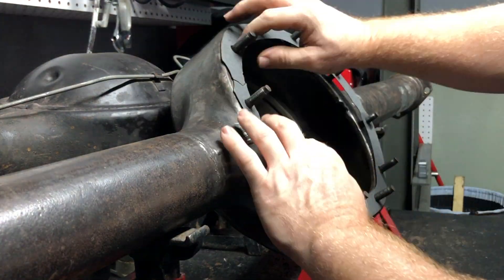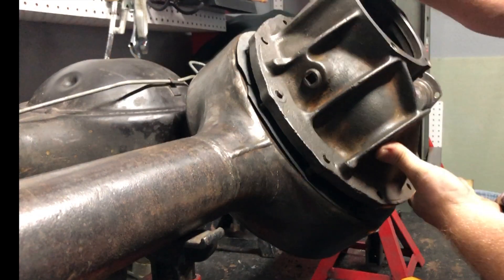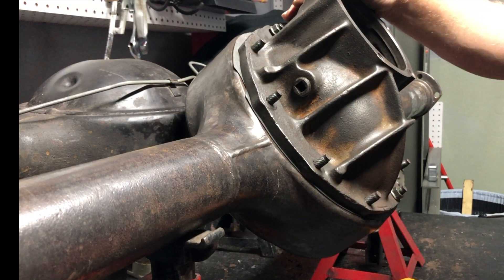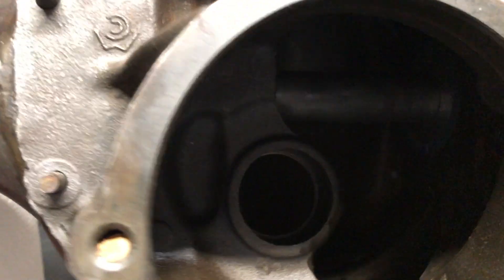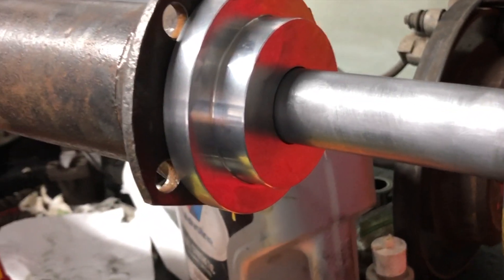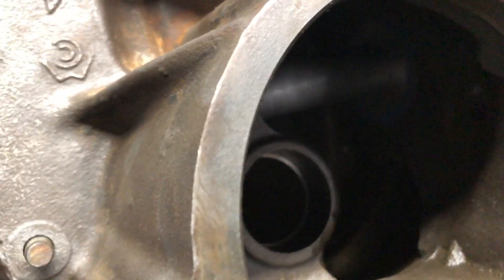After setting that up I put an old gasket on the housing so that the gap would be right, holding the center section in, and I just put a couple bolts to hold that in place. Here's the look of it going through the center section and then what it would look like on the ends — just making sure everything spins freely before you start welding it up.